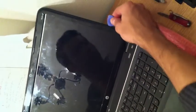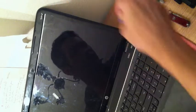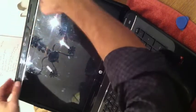After removing the plastic snaps along the edge of the plastic bezel of the front cover of the LCD screen using either a pick or a hard plastic sharp piece, or even a small knife or your fingernails, just run across the edges as you hear the snaps come around. It's easier to start from the top and snap your way all the way down to the bottom.